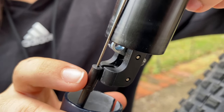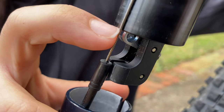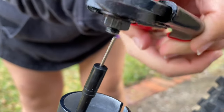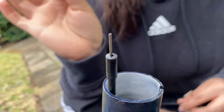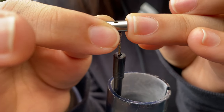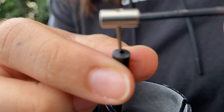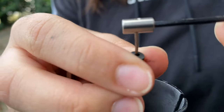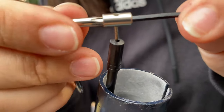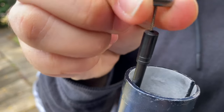For my bike, I am going to need just about this much of the cable wiring, so I am going to cut off the rest of it. Next you are going to want to grab your cable barrel actuator that came with your dropper post package and insert it, but just through the very tip — not all the way in, right about there. With an Allen wrench, find the correct size that fits the bottom of it and tighten it on both sides. Make sure that it is tight enough.